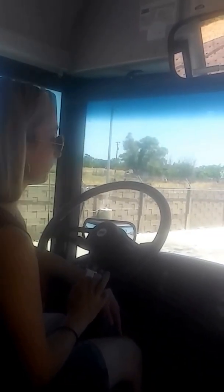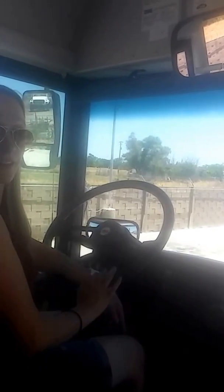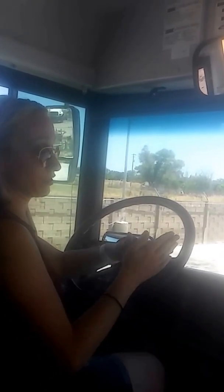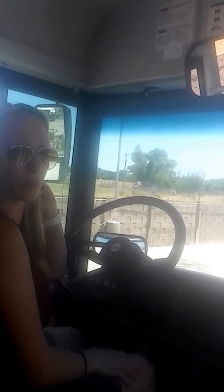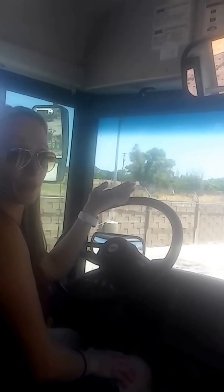It's at 90. So you definitely could hear that air that time, right? Mm-hmm. I really pushed it hard so I get all that air to come out. Okay. But that's how you know that your front brakes aren't just being applied, that you can hear the air expelling out of that spring brake chamber, allowing that spring to expand and it's applying the rear brakes. Okay. In place of the air, right? Since we don't have air in the rear. But we still have 4 brakes, 4 chambers being applied to stop this bus safely.